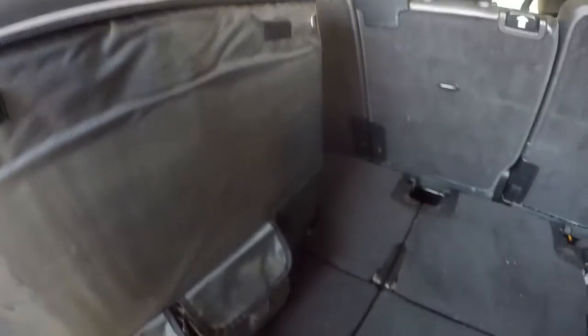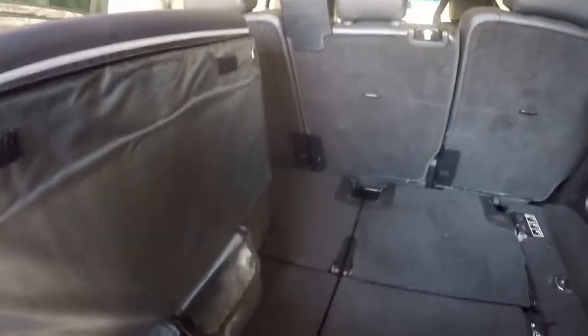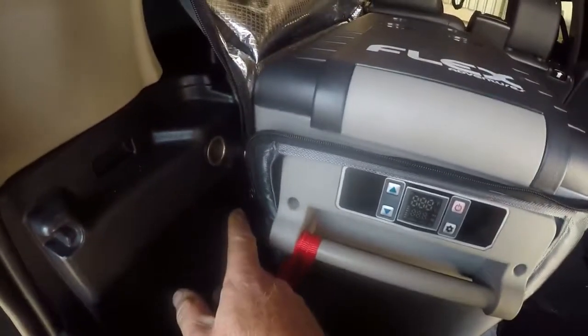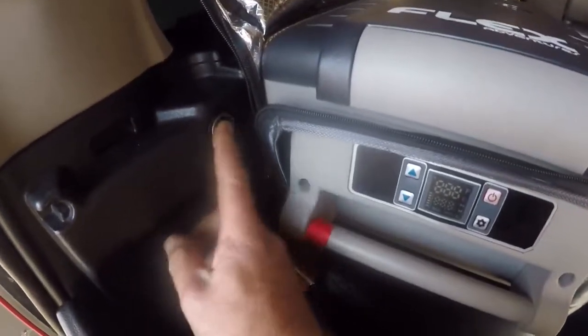As I said, the vents are not blocked up or anything. It's pretty far away from the edge of the inside of the load bay. And then of course I have my 220 volt power supply there and my extra 12 volt power supply over there. As I said, I bought 2, so that just plugs straight in, but you know that when you're driving, that is not very stable. They tend to pull out, so that's why I connected my permanent one with an Anderson plug onto this power supply over here. You can actually hear the compressor running there. Very quiet. This is such an awesome fridge.